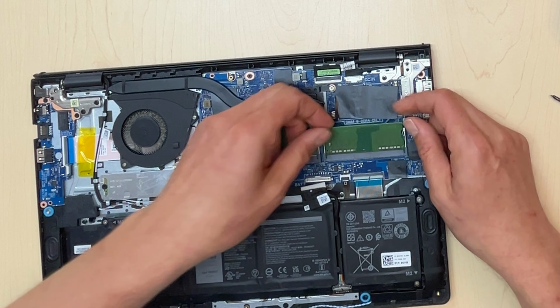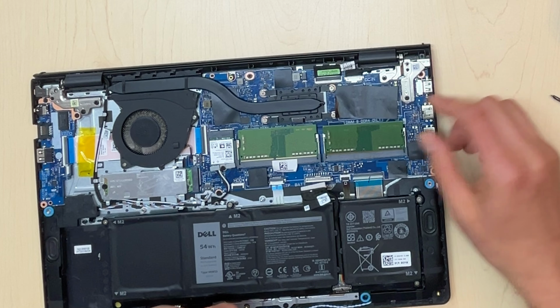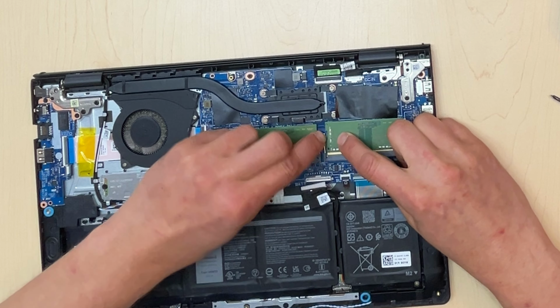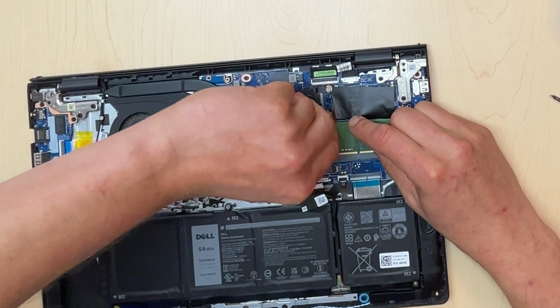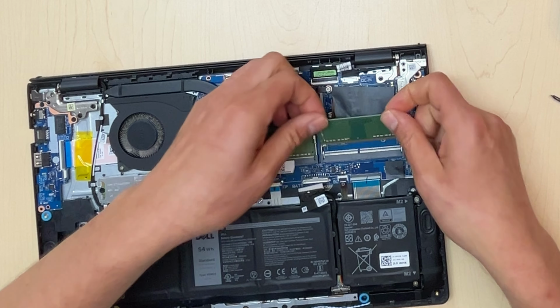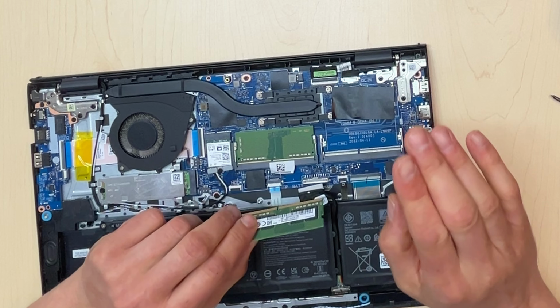I would just go ahead and remove the RAM one by one and plug the power cable in, going one by one to see if removing the RAM fixes it. Could be a bad RAM, could be that the RAM just needs to be reseated, removed, cleaned out a little bit. I am not using compressed air, neither an air compressor.